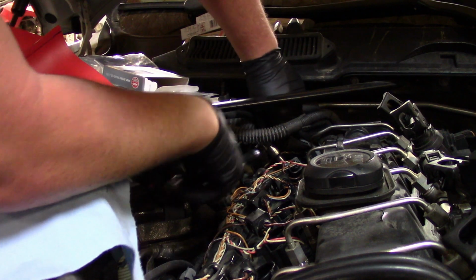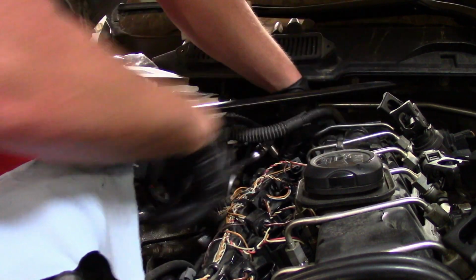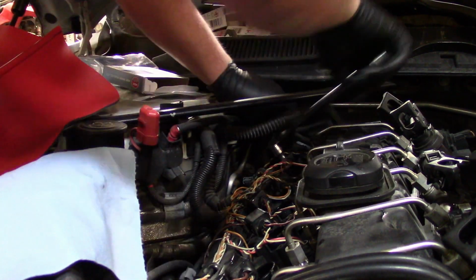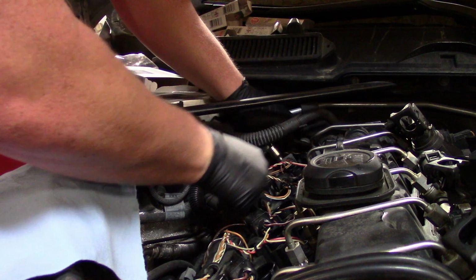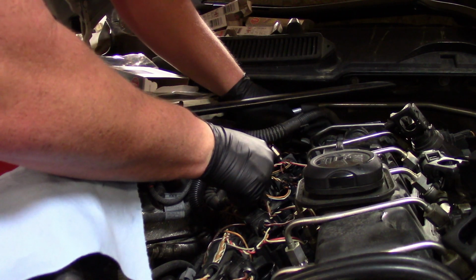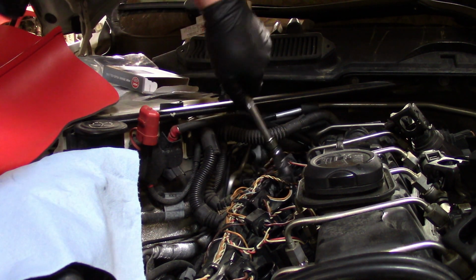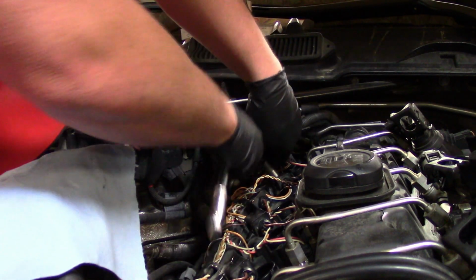Okay, these are crush washer style seal, so finger tight, and then I think it's like 3/4 of a turn. It's definitely more than 3/4 of a turn. There we go. Now it's touching. Right there you can feel it get quite a bit tighter. So that's how far you go. Don't want to overtighten them. Nothing worse than an overtight spark plug. There it is, plain as day. You can feel it as soon as the washer is crushed all the way.